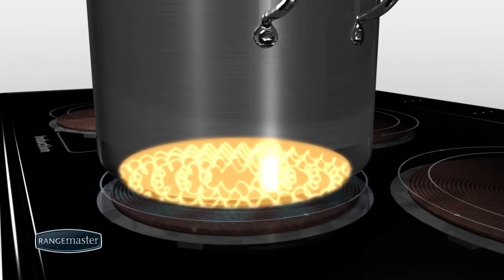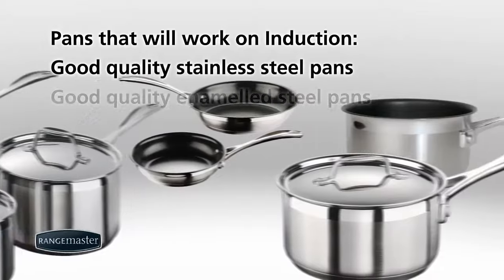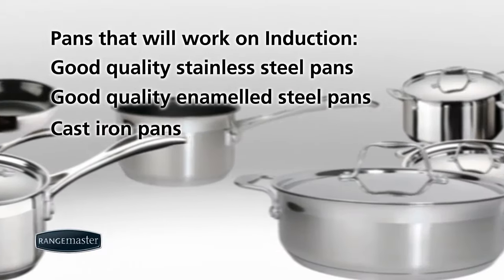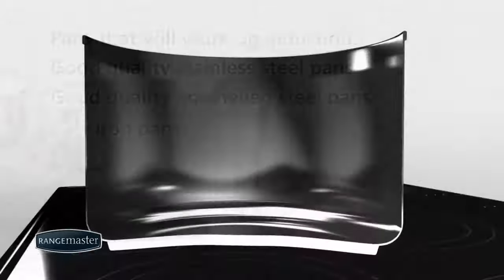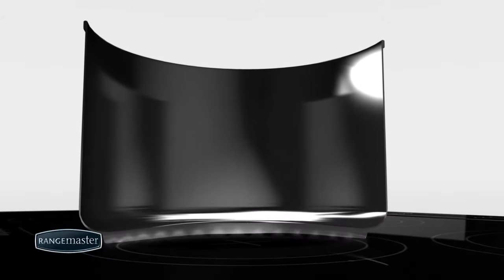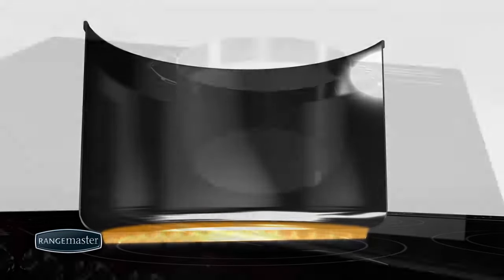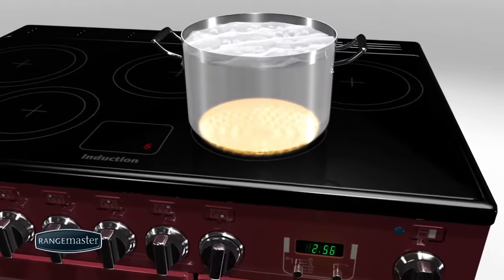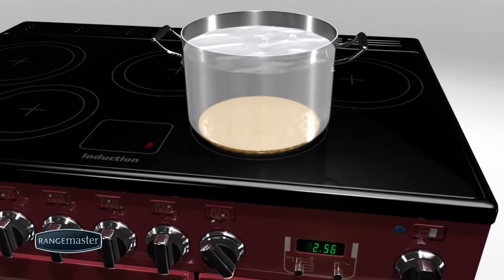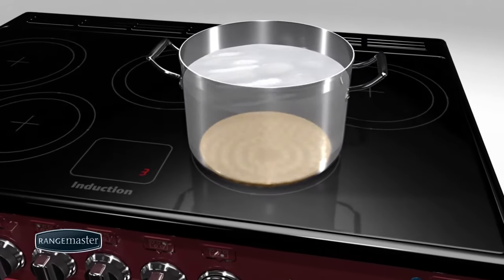The pan's contents can now be directly controlled. Not all pans will work on induction hobs. Pans should be made from good quality steel or iron with a thick and ideally slightly concave base. If a magnet sticks to the base of a pan, it may indicate that it is suitable for use on induction. Any adjustment of the power has an instant effect upon the metal of the pan base and is immediately transferred to the food being cooked, giving you total control.